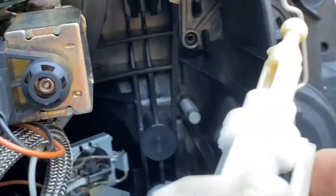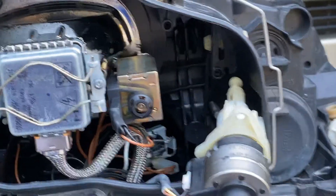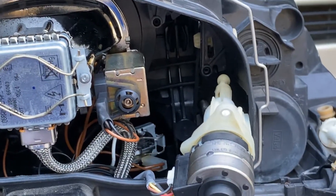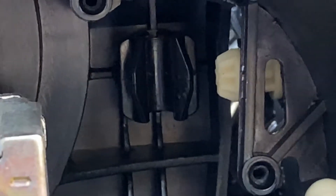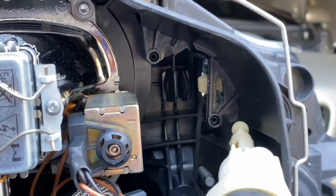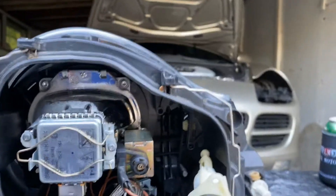When you put your lights in, your headlight adjusters will work. If you just throw it on there and screw it in without it being attached to that back socket, you're going to get a warning saying 'dipping headlight.' Trust me — when you have to drive 40 miles from a drive-in in the dark with both headlights dipping and you can't see past 20 feet in front of you, you learn how to fix it real quick. I hope that helps. Sorry for the crude videotaping — I just felt it was necessary since I didn't think anybody else had anything like this online. Good luck.